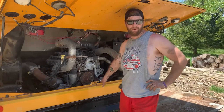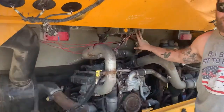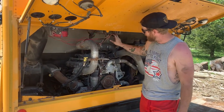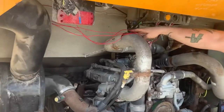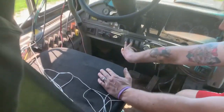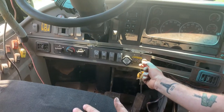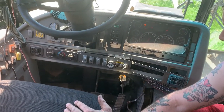For the past couple of weeks we've had a problem with starting the bus from the key inside the bus. And as everybody knows, there's a starter back here also. So what I did was I just took this out, ran wires — I haven't really made them look fancy yet — but ran a bunch of wires to the front. Now we have the ignition and the on switch right there. So all we have to do now is turn the key into the on position and switch the ignition up.